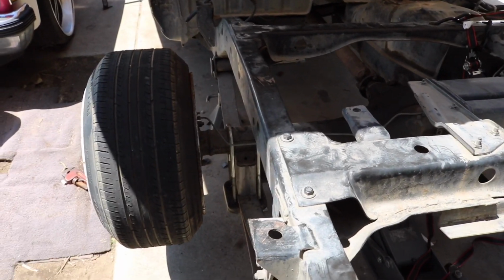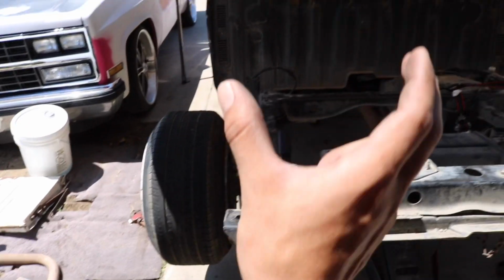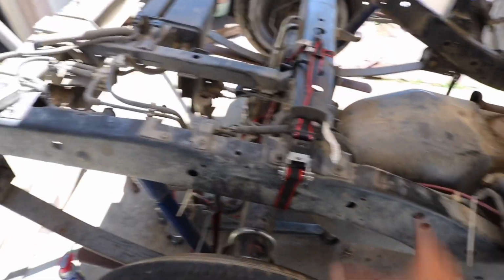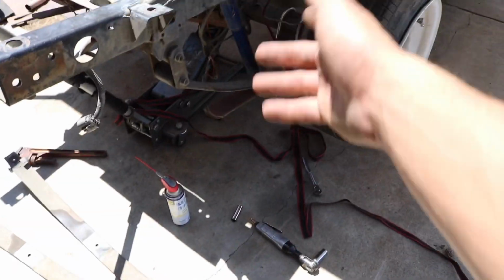So it could shift from about 1/8 of an inch to 1/4 of an inch, maybe a little more. It does have a lot of wiggle room. I know a lot of people think, oh, just tighten these and it'll center itself, but it doesn't center itself. So if you do that wrong and it shifted over a little crooked, your tires can get worn out. But regardless, when you're installing blocks and doing aftermarket stuff like this, it's gonna affect the truck a little bit because it's not OEM. But I figured I'd just mention that.